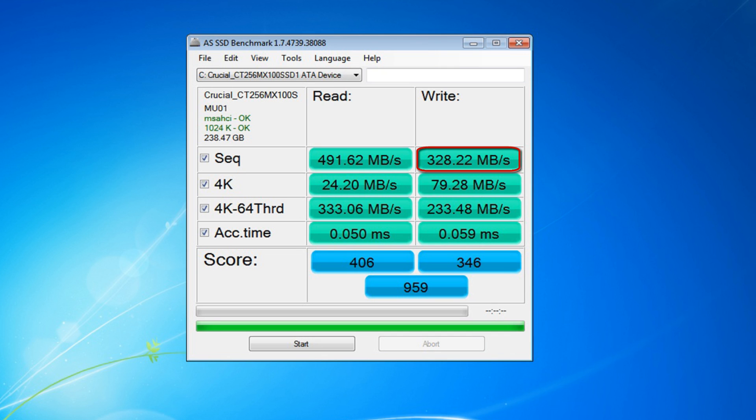For write speeds, 328 megabytes per second — impressive as well. This is a fast drive for writing files, transferring files, or writing a 2-gigabyte file in next to no time. Looking at the 4K read and write speeds — very crucial speeds for everyday usage, opening up your browser, browsing the web, doing everyday tasks — this is where the SSD is going to shine. When compared to a hard disk drive, I actually had to stop the benchmark on the HDD because it would have taken half an hour just to do one slot of the 4K random reads.